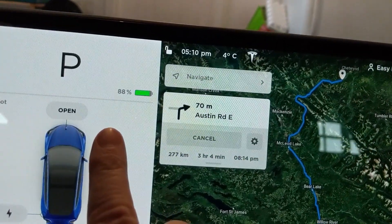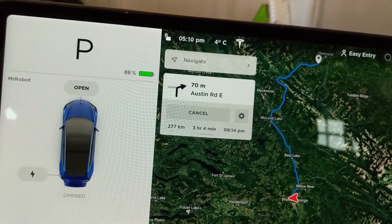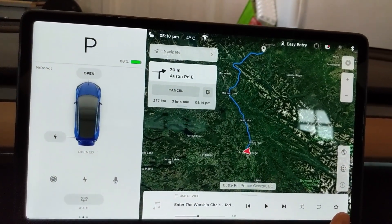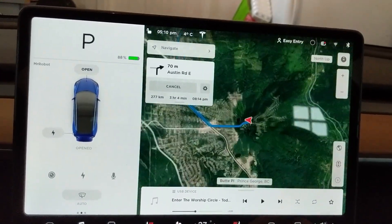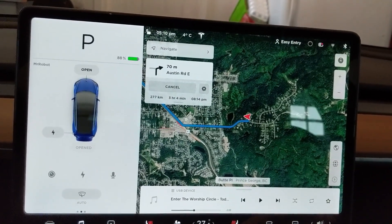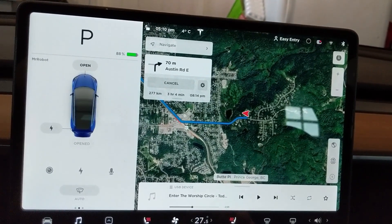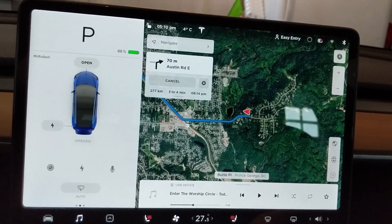In the meantime, we're still at 88%, so it's taking a while to burn off some energy. I'll stop the video and come back once the car has dropped down. I'll charge a little bit with the Tesla wall charger, then with the NEMA 14-50, and then with the regular 110-volt outlet here in the garage — we'll compare those three. That will be good to know, because when I get to the campsite I'll be using the NEMA 14-50, which is the same as an RV plug.